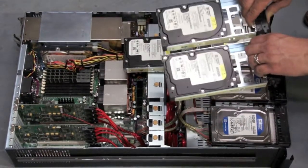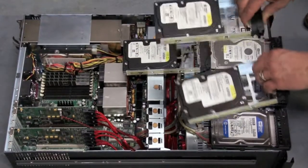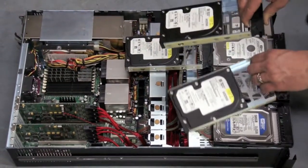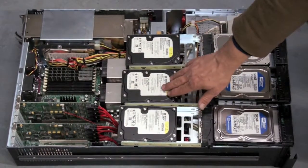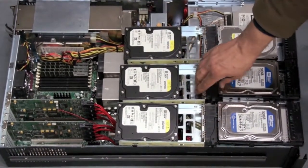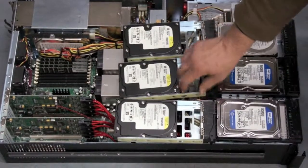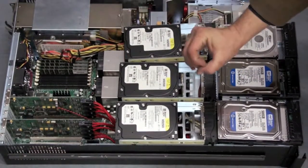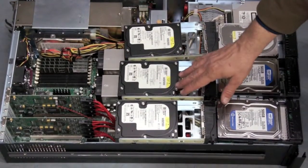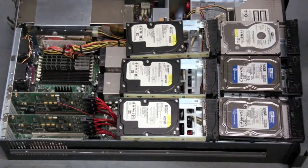So it gives you twice the read bandwidth with data reliability if you lose any one hard drive. Well, what about that? That only means that you get 50% of your data, so I only get 250 gigs on that hard drive, even though I have 2 250 gig hard drives. So RAID 1 is very, very fast, but you lose 50% of your capacity.